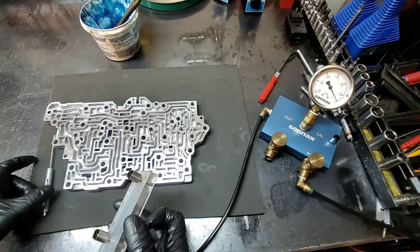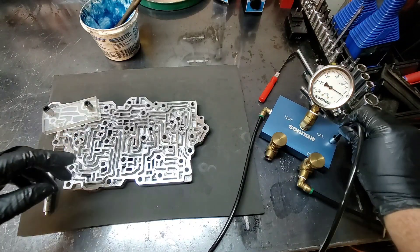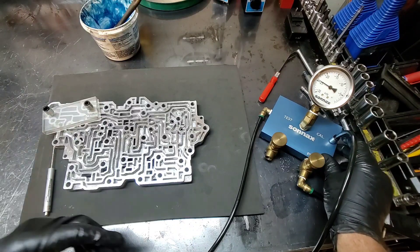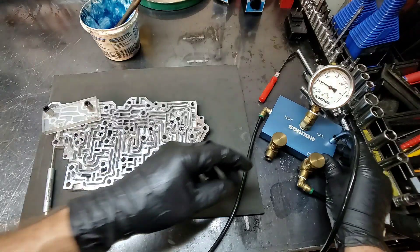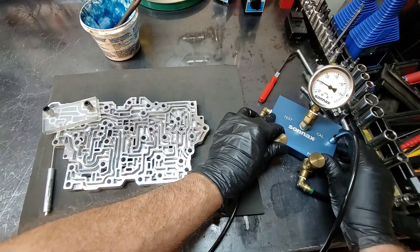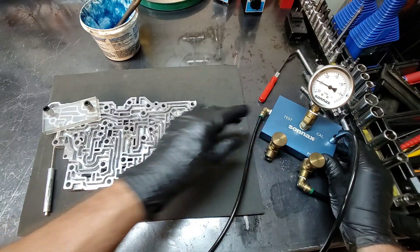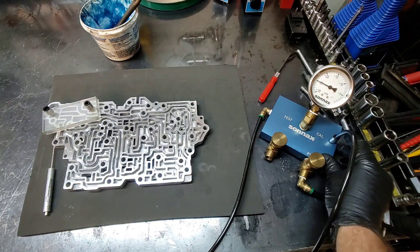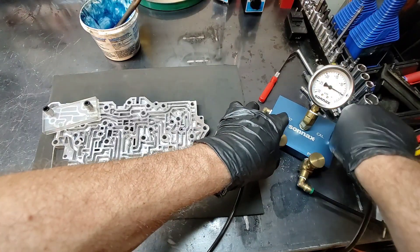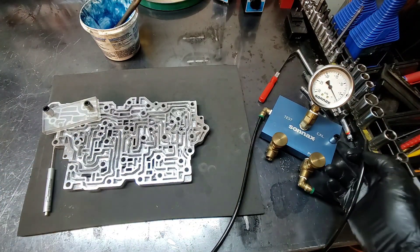Before you begin using it, you always calibrate it. We need 5 and 25, depending on humidity, temperature, and so on. We're at 24 and a half, so I'll move it a little bit to get to 5 and 25. Now we're at 25 right on the money, and we're at 5. You adjust this to 5 and the other to 25. When you have an open, this is a 35 — 30 or 35 thousandths of an inch — calibration hole, so you calibrate it for that leakage.